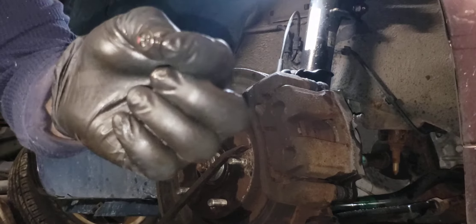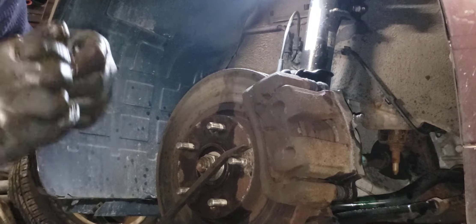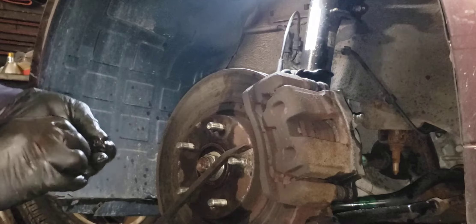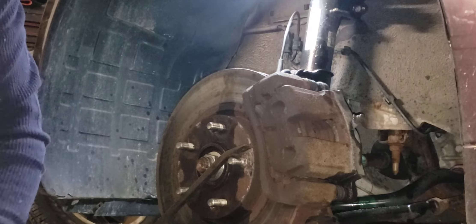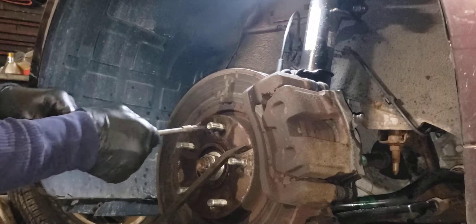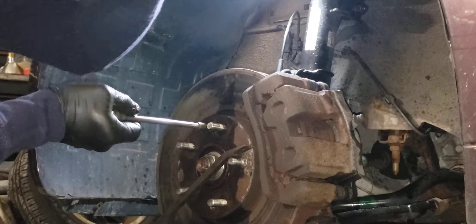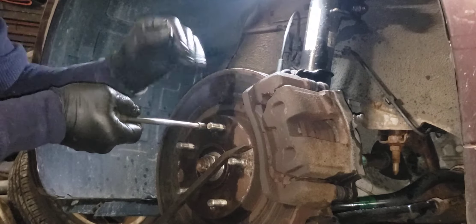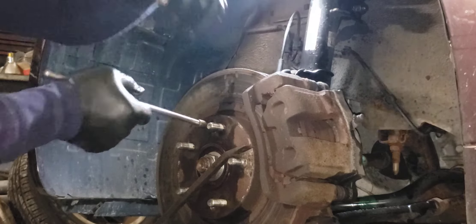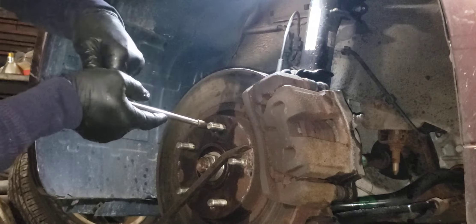This is the screw — the bolt — that holds this. Trust me, this is not what's holding the rotor on; even two of them won't hold it if something fails. That's how you get them out. Once you get this off and get the caliper and caliper bracket off, this rotor may be fused. Beat it with a hammer, and on the back side you might have to turn the wheel and hit it on the back side.